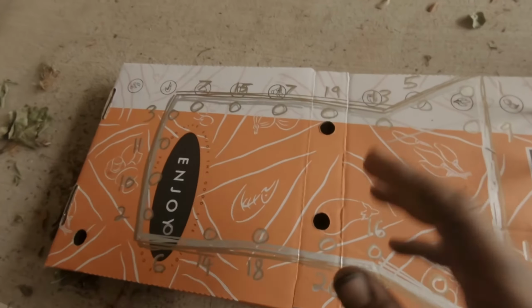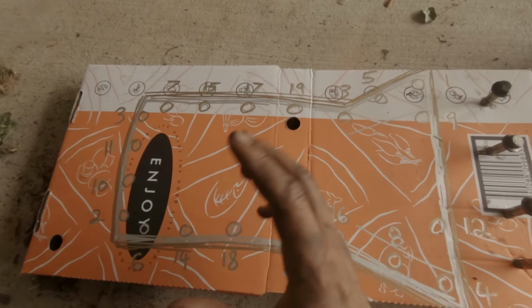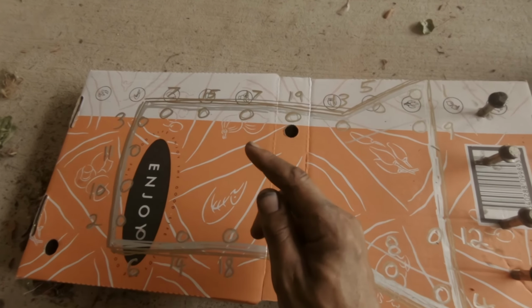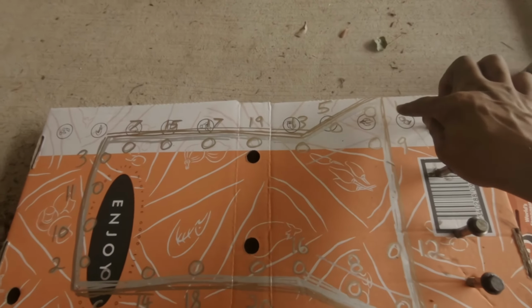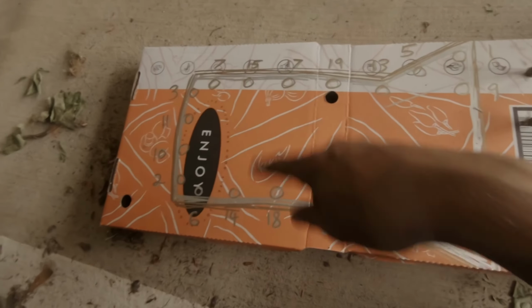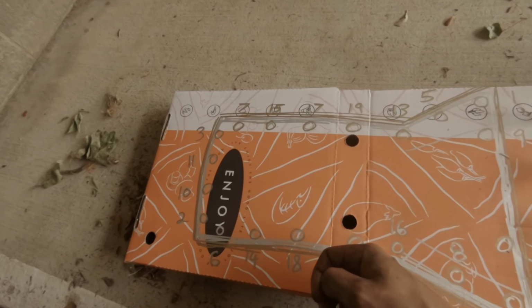The rest of the bolts, however, the bolts that face vertical on the sump, need to be taken off in a specific order. There is a loosening and a tightening sequence for them. As you can see, it goes 1, 2, 3, 4, and so on, basically round in a circle. And there are 3 or 4 different sizes.